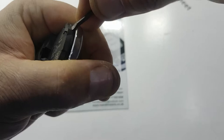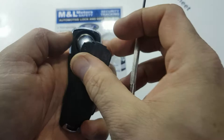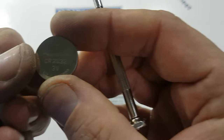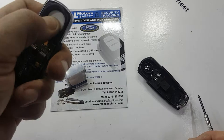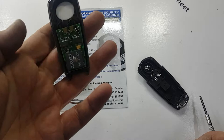It's not exactly easy to separate these keys, but if you can't get it on that side you can try the other side. It's quite simple — you'll find it will peel away and reveal the battery. On this key it looks like it's another CR2032 3-volt lithium cell. Just think about the Vauxhall badge — the battery is located literally underneath the Vauxhall badge on this type of transponder.